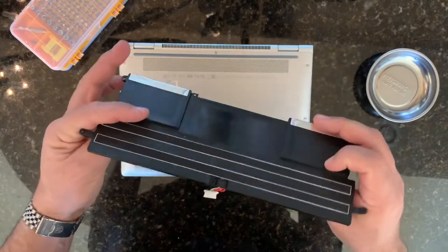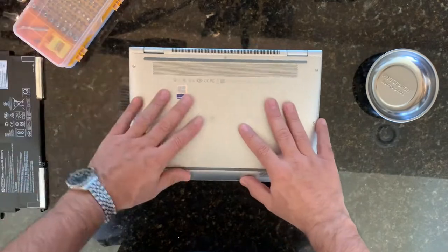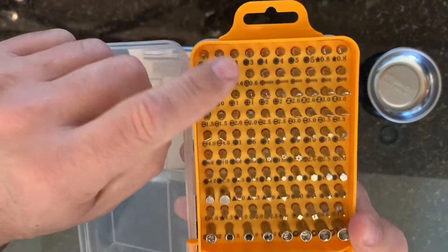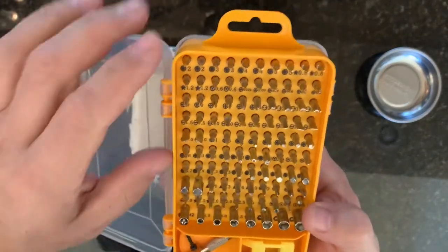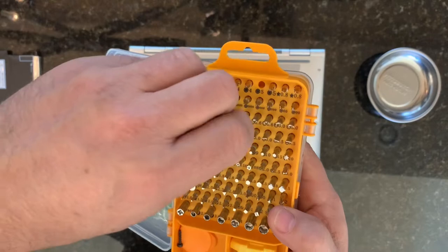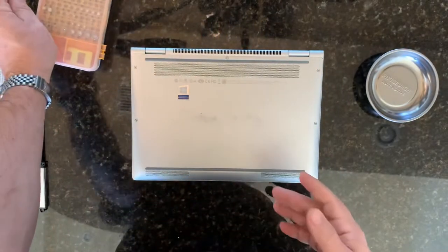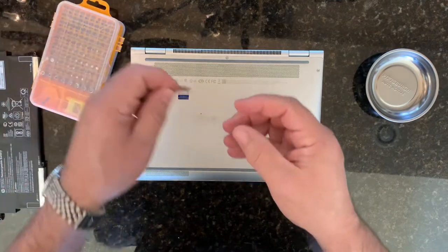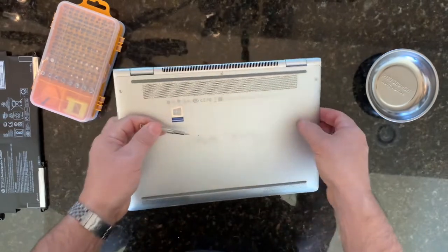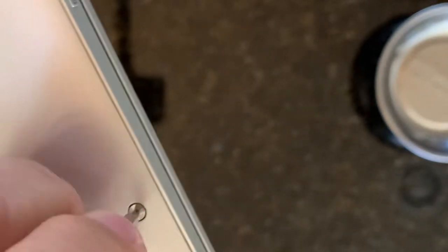You can find these on Amazon — I'll put a link in the description of the video. To take it apart and take the battery out, you're going to need one of these kits with very very small Torx bits — all these very very tiny ones. This one uses a number five star pattern bit, and if you don't have this, these bolts are just way too small to use anything else to try to loosen them up. It just needs a finger turn, but the actual bolts — the heads of them — are just very very small.